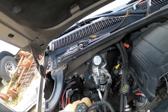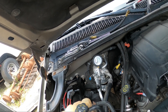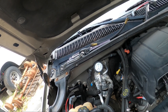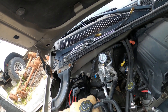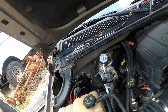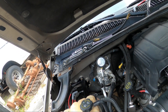Okay, I had to film this because it's the weirdest thing - I'm back on cylinder number two retesting it and it's holding 160 PSI now. Really, I don't know what to think. You've seen what it did on camera earlier, so we'll take it. I have no clue what's going on with that. Maybe because it was the first one I was testing the lifter wasn't fully pumped up yet, since it's been sitting since I parked it after work yesterday around 6 PM. We're going to count that one as 160 PSI - that's really odd.